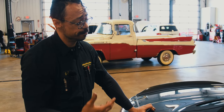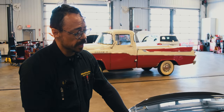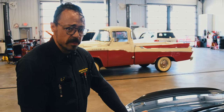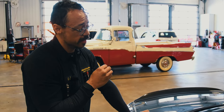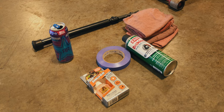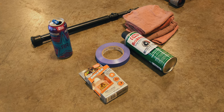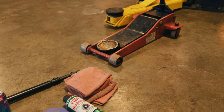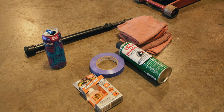Keep in mind I'm not a convertible top expert on upholstery. The customer has already spent a bunch of money trying to get this fixed, so I'm trying to come up with something low-budget to get this window glass sealed up that will keep it sealed and keep the glass from hitting when it operates. We're going to be using Gorilla Glue, 3M masking tape, brake clean to clean off the old seals, and clamps to hold the glass in place while the glue sets and dries.